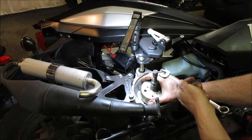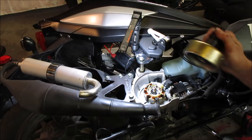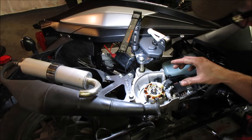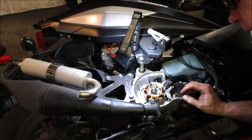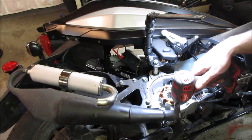You need something to support it. There it goes. We're in. I'm not seeing anything jump out at us right away. Let's keep digging. It just seems like the way it quit so quickly, possibly the seal blew out. Could be on the other side too yet. Sometimes you could draw a little vacuum on the crankcase if you have the capacity to do so, and you could tell if you have a leaking seal.